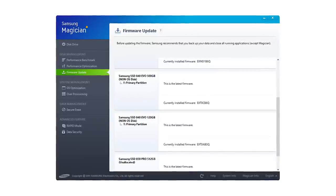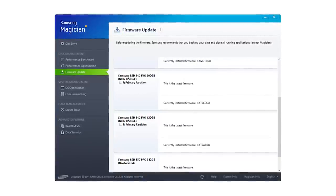The tool is actually available to the public now. So what is the process the tool takes you through if you have an 840 EVO SSD? This is not your typical Samsung Magician click-on firmware update process — it is not the same thing, because there are some additional steps that must be taken with regard to how the flash was and is initialized within the SSD.